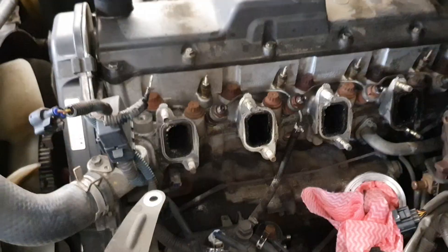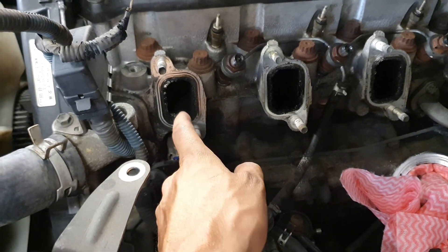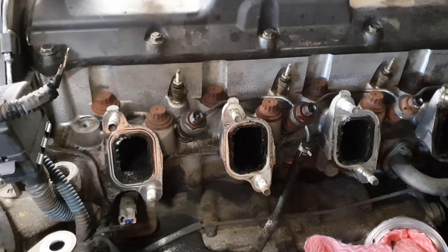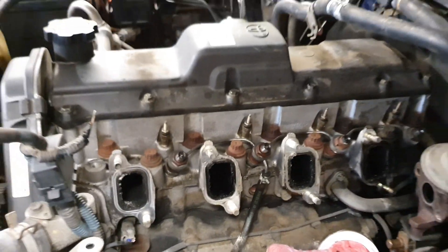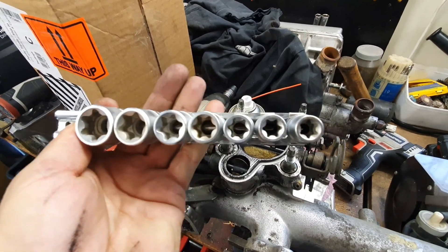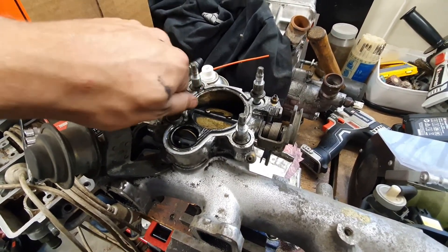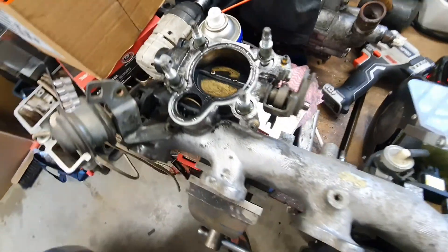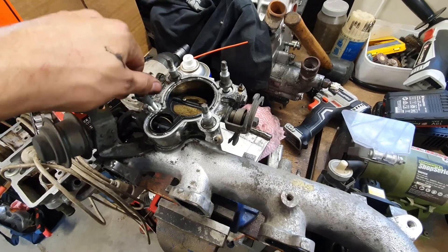In here, I plan to turn the crank around and close the valve up, then work on each port and clean out the best I can from this end, blow all the crap out, and work through each one as I go - whichever ones are closed at the same time. At least I know it's all as clean as it's going to get without taking the head off. I've cracked all these bolts with a six-point socket - these are now loose so I can unwind them and pull the throttle body off, leaving just the bare manifold to clean and scrub.